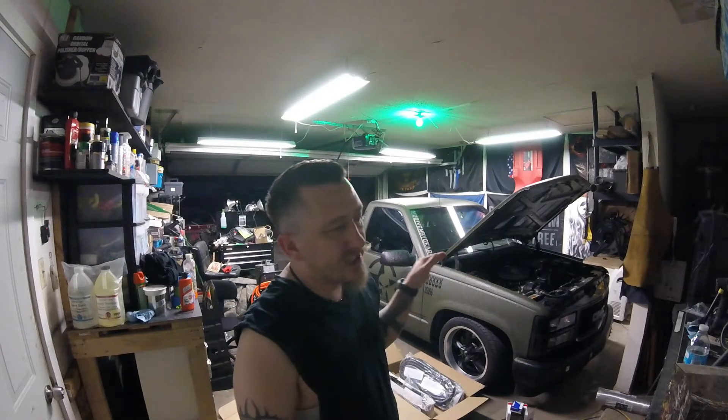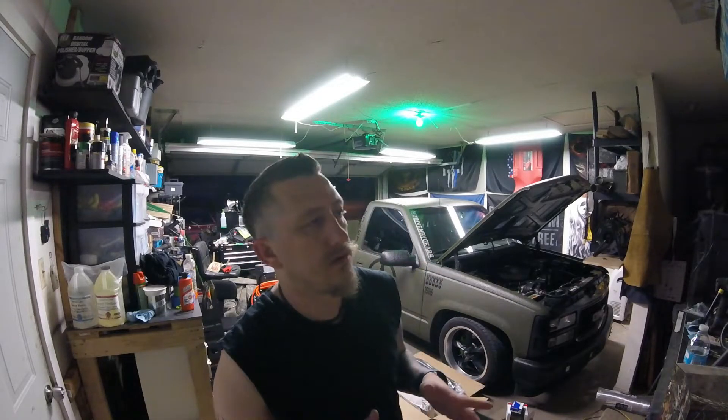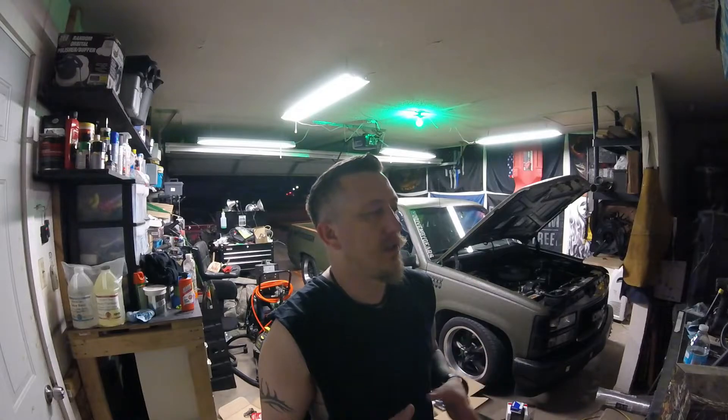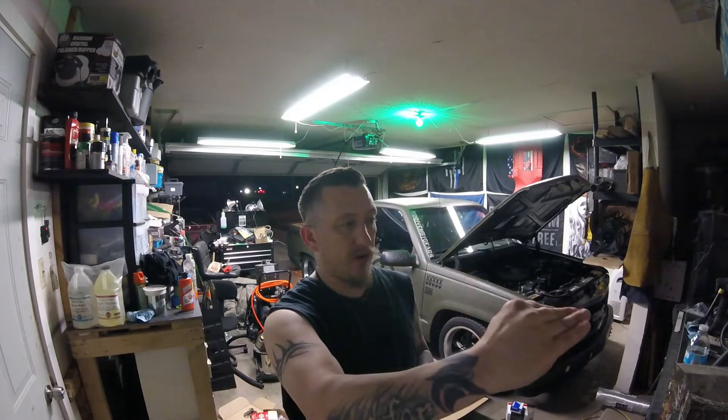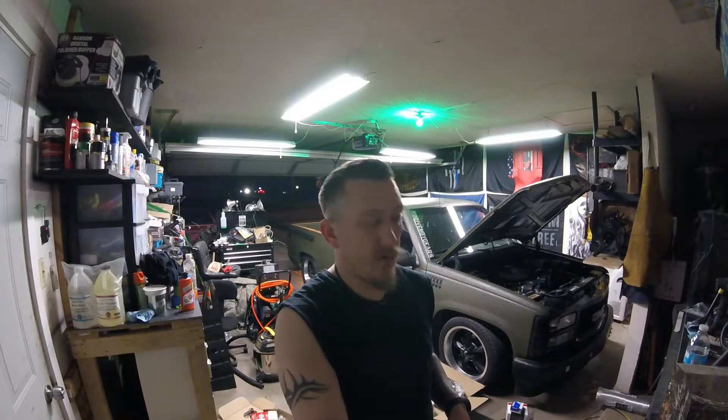On the seating — I've got the seat sitting a little too high, so I'm going to make a video about seat adjustment to try to get the racing seats more comfortable. Right now I just mounted it at the stock bench seat height, straight to the same frame. I read that you need to set up your racing seat so your eyesight is level with the middle of the windshield, your feet sit on the floor comfortably with a little arch in your knee, and you can fully press the gas all the way down — which I can't do right now.